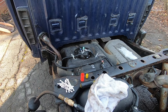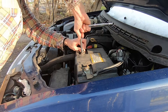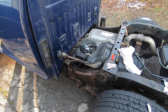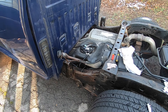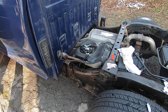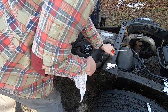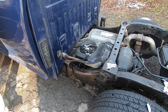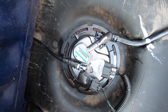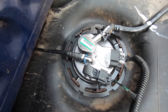I'm going to turn on the truck and see if we see any leaks. I'm just going to touch this battery terminal with a little bit of dielectric grease while I'm in here. As soon as you turn the key, the fuel pump will come on to prime the line, so I'm going to try to move quick. It would be helpful if you had a friend to get an eye on it and see if there are any leaks. I heard it and it didn't sound like there were any problems — the truck is running, I don't see any leaks at all. It looks like we are in business.